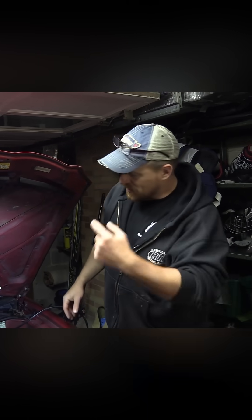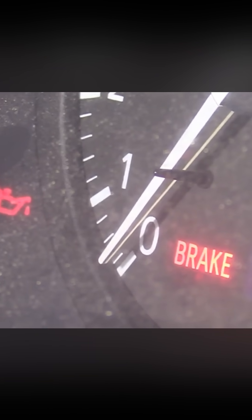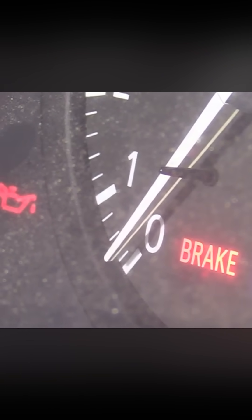Let's go inside and watch the tachometer — see if we have a little tachometer bounce. That'll give us some good direction. See the flutter of that needle? That tells me we have good inputs as far as the needle bouncing. And as I'm sitting here, this is the first time I noticed this: I smell fuel. That suggests our injectors are firing, and so we're going in a completely different direction than I thought.